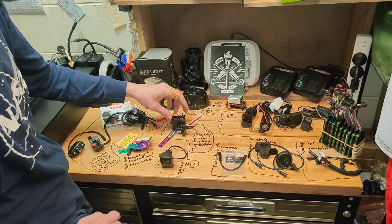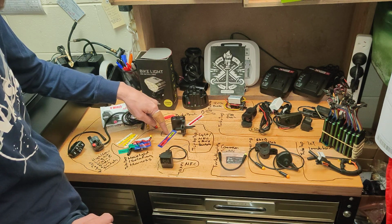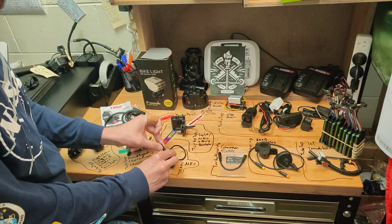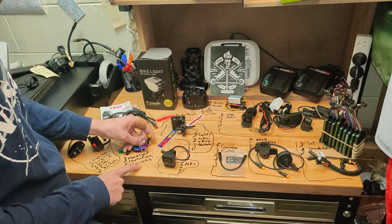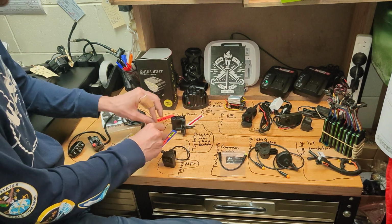The TurboTap light NFC auxiliary switch can connect to the NFC, in line with the 3-pin, or those same 3 pins off the light horn switch isolation harness to turn your headlights on and off. That's the dual purpose you could switch it to.